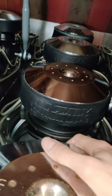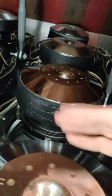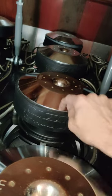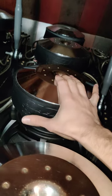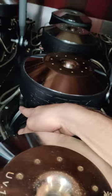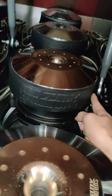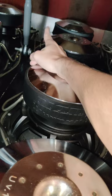Series is a little bit different — it basically adds ohms. So if you had a one ohm speaker, it would double it to two ohms. To wire in series, you take one coil and do positive to negative as a jumper, then run the negative of this coil to the back.